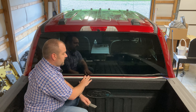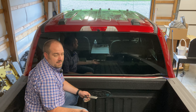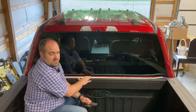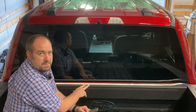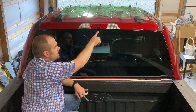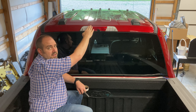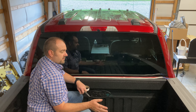We store a lot of things in the bed when we're camping - usually have my generator back here, the fifth-wheel hitch in the back of the truck, sometimes some tools, and a lot of times some firewood. Tonneau covers do a great job of keeping those things covered up. I did consider the flip system - that is a great system. A couple things I don't like about the flip tonneau covers is when you leave the back section down for towing, it does impede the view of this high mount camera from seeing your hitch. Second thing is if you fold it all the way up on an eight-foot bed, it actually sticks above the camera and totally blocks the camera and your rearview window. So that's one of the reasons I wanted to go with a rolling tonneau cover.